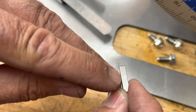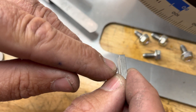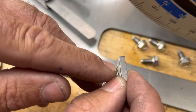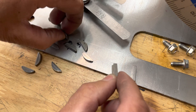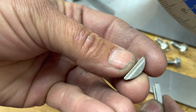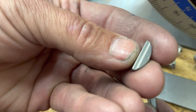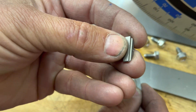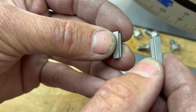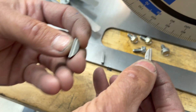You're moving the flywheel that direction. They say about eight thousandths of an inch is worth one degree of timing. Now here we have a three key. It has a mark on it that says three. These are genuine Honda keys — I ordered every one they had just to check them out. See how that slot is much more shallow than this slot? That's only going to move at three degrees; this is going to move at six degrees.